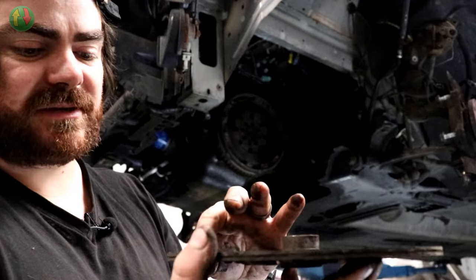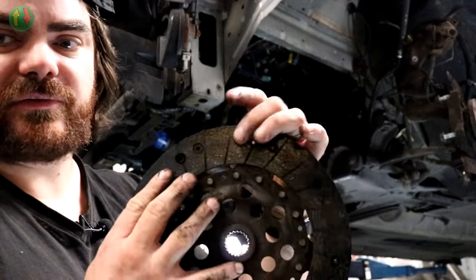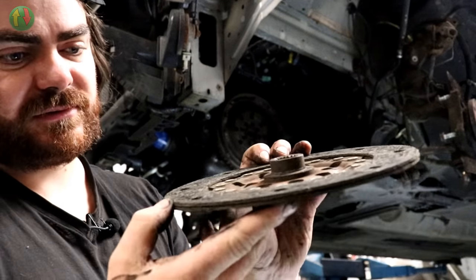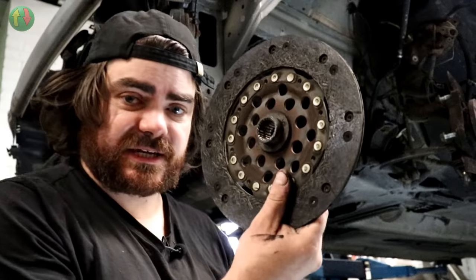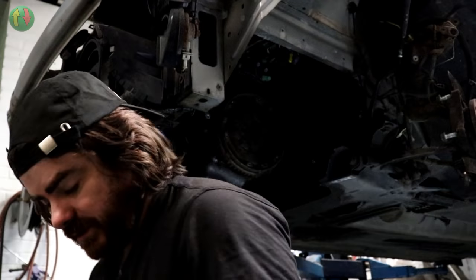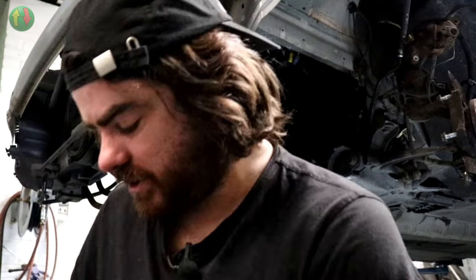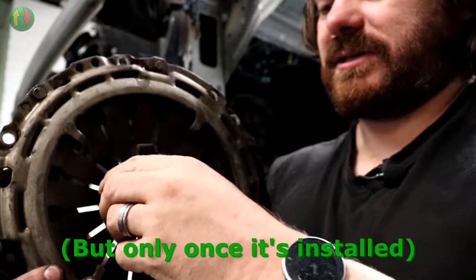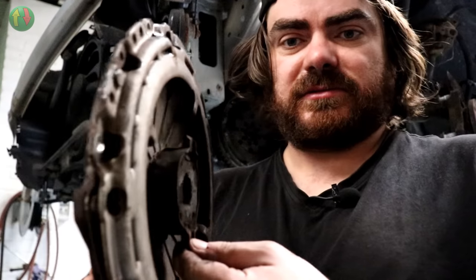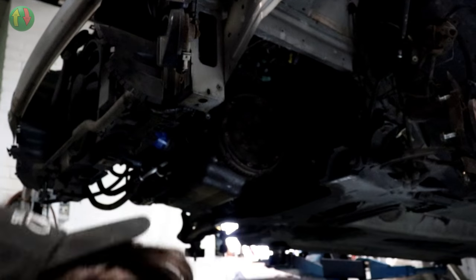Originally there were machine marks here - there are none left on that side. You hear the saying 'down to the rivets' - the rivets hold the whole thing together. That clutch has had its life and done its job, so it's no good. The release bearing is actually part of the cover and is absolutely ruined - that'll be what the funny noise was when driving it.